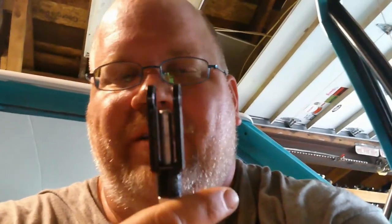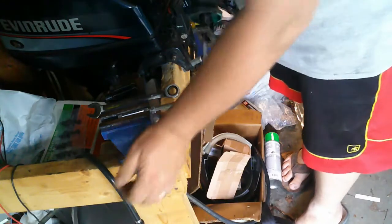Okay, so the contraption of this inner threaded rod right here, I'm gonna have to cut down some, get it to go on the pedal. Now, I'm learning as I go, and I really hope this video helps some of y'all out, because you can learn from some of my mistakes and not go through some of the ish I'm going through. But I'm going to have to cut it down some. Also, if you want to make your job easier, stick this in the master cylinder before you poke it through the firewall. It would have made my job easier. But anyway, I'm going to go ahead and cut the piece down, put it back together, and we're going to try again. All right, I'm not feeling doing the hacksaw thing again, so.